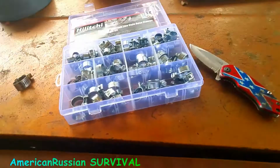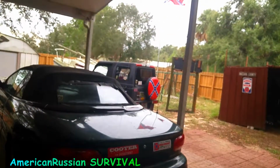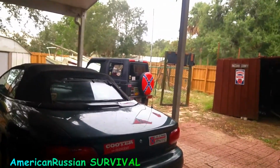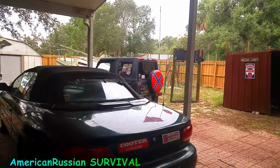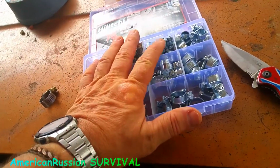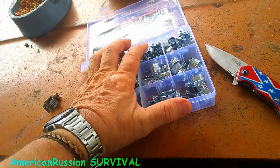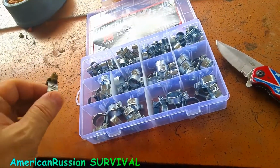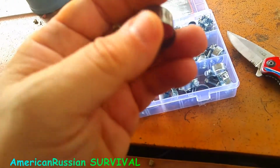And actually what happened with that thing was I put a 1/4 inch line and I jammed it on a 3/8 fitting. So it lasted for a couple years, but eventually the hose split. The rubber hoses actually last a pretty long time if you do them right and you use the right clamps. And usually if you have a failure point, the failure point is right at the clamp. And with these type of clamps, you're going to have less problems with the hose getting all chopped up.